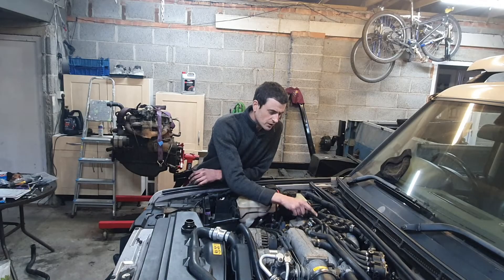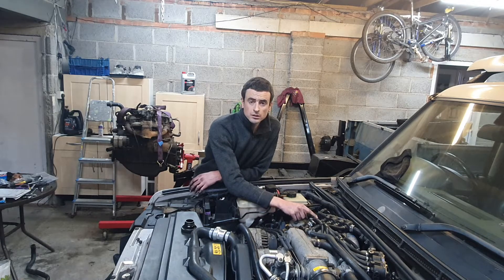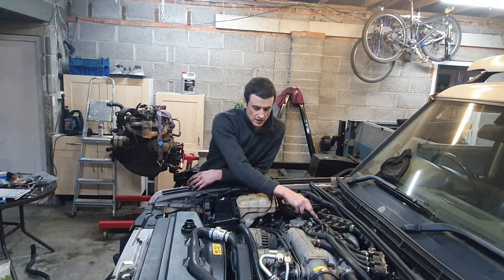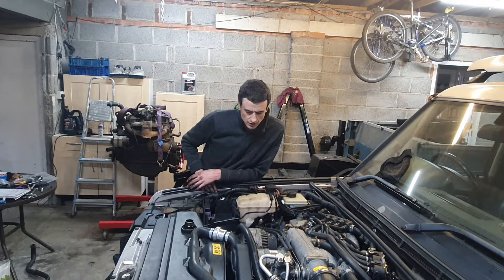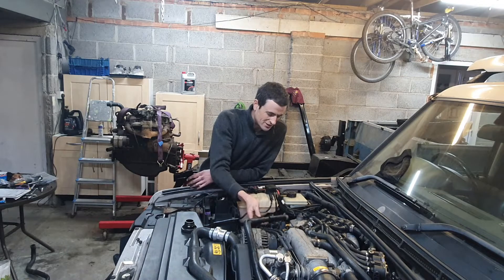I can put the front of the car on next. I've left this hose clamp off — I'm going to pull that hose off to bleed; that's the highest point in the coolant circuit. And there's another high point here, so that one already has a bleed, but this one does not. This is the hose to the LPG reducer and to the heater matrix. I'm going to bleed that one probably while it's running, and try them both while I'm filling it up, then again when I'm running it. That hose needs to go in there as well.